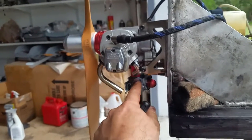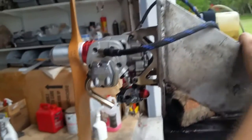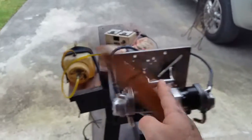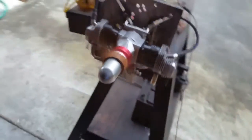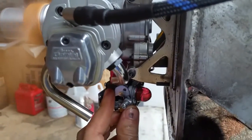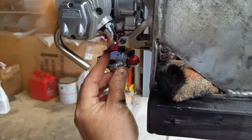That's why I had it in this position, close to the fuselage line. Let me lean it up a little bit — just little by little, maybe an eighth of a turn or so. I have to bring the idle up a little bit. Right now it's around 1300 to 1400 RPM, and that's what I would suggest. It sounds much better in transition.